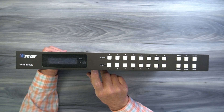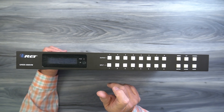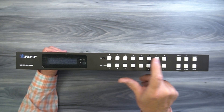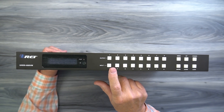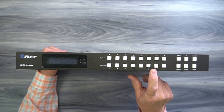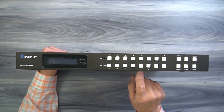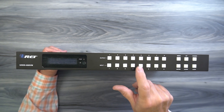If you mount this inside of a cabinet, you can use the included infrared extender kit, locate the receiver outside the cabinet, and plug it into a port in the back. To the right of that you'll find eight buttons labeled output one through eight and eight more labeled input one through eight, where you can make configuration changes as to which input is sent to which output. To do that, you'll first select the output you'd like to change - let's say four - and then select the input you'd like sent to that output - let's say seven. Once you tap those two buttons, input seven is sent to output four.